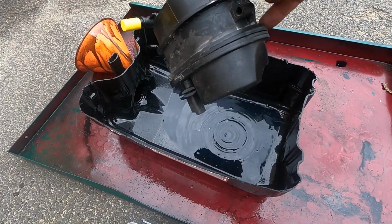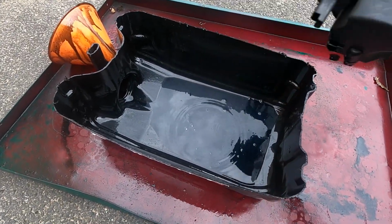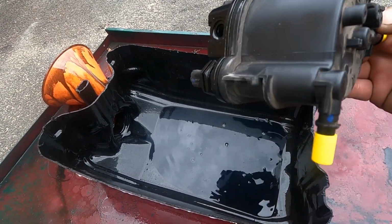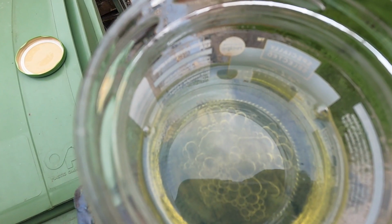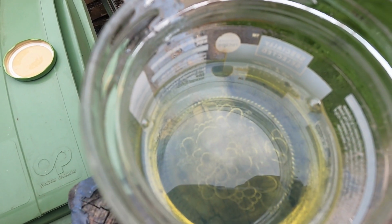And if you drain diesel filters out, sometimes you'll see a little globule of water skate across the diesel before it sinks to the bottom, yeah? Which you can probably see there. There is a couple of droplets there. Now this filter system, this is a sedimenter, has sensors in it, so I'll show you that in a minute, but there you can see the little globules. They're starting to join together. Yeah, water does that. Okay, so now you see it. It can't be unseen, can it?